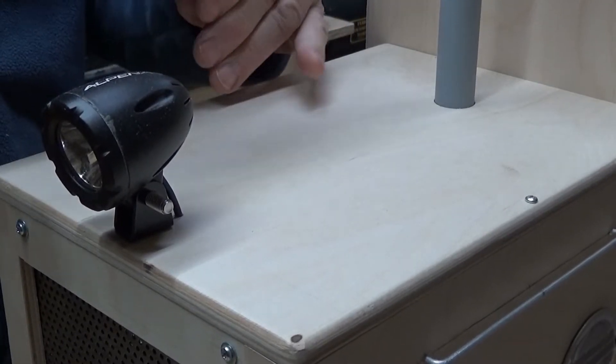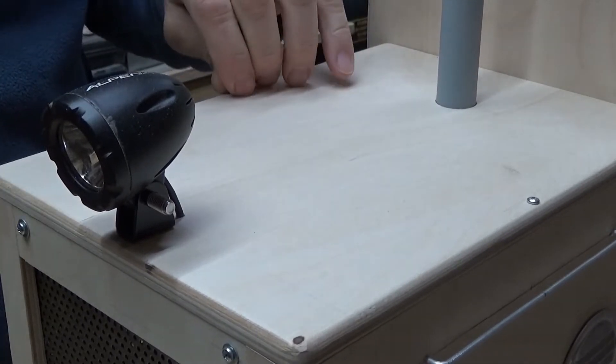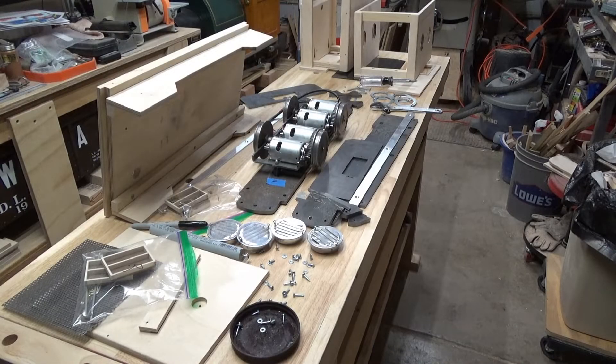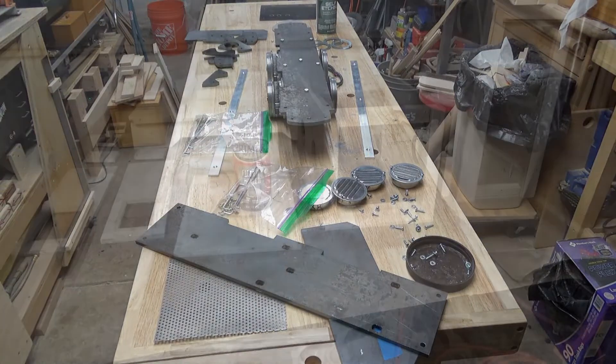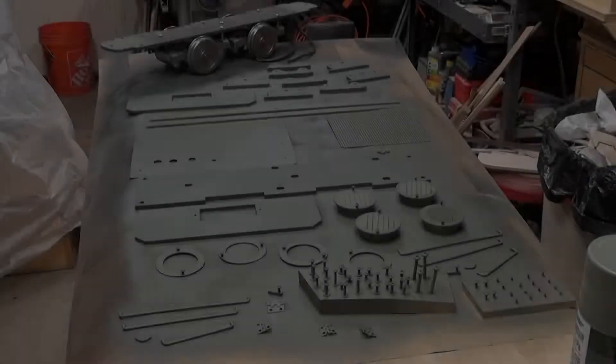It's not going to paint itself, so let me tear everything apart and start to get everything primed and painted. Well, there's a boatload of parts there. I've got to get everything sorted out, figure out which ones need etching primer — the metal parts — and which ones need sandable primer, and then figure out some of the final colors. This pile gets the etching primer, and this pile the sanding primer.